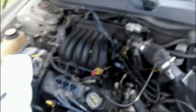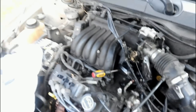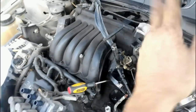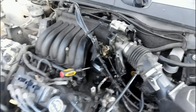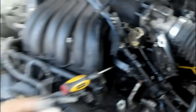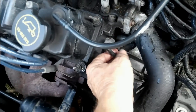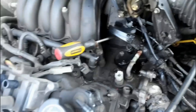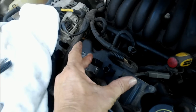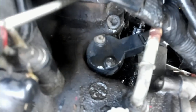Ford didn't make it easy — they put this big wiring harness right across the top of it when they could have ran it somewhere else. I unhooked the little spring off the throttle here, which is laying off to the side, unhooked the throttle cable and pushed that off to the side. Then I unhooked the sensor that was right here because it's hooked onto this wiring harness on the bottom — when you unhook this, it'll allow you to push the wiring harness out of the way. Then I took these spark plug wires, numbered them, and pushed them back out of the way. I've got a screwdriver here to prop it, and there is the cam sensor.